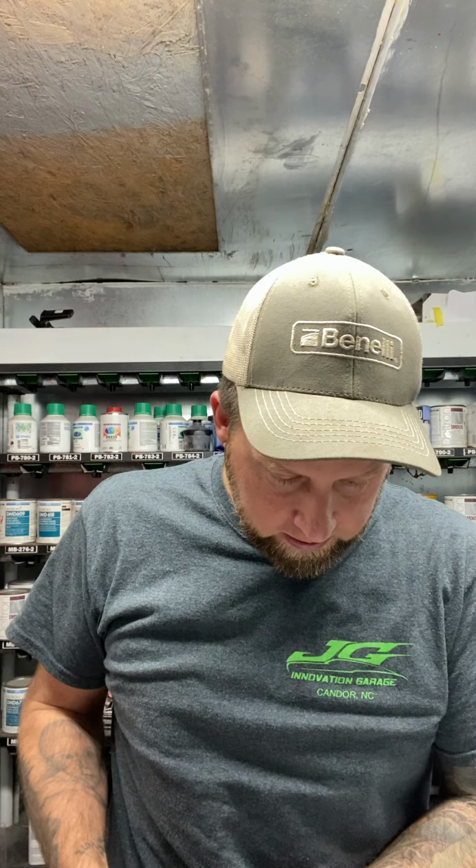That's why when it says the wet bed, that's when you put it on wet, the wet film, the film build or the mil build wet is 2.5. And then it says dry film build 1.5. Well, that means it lost 1 mil between drying. Everything shrinks.